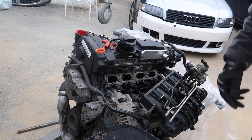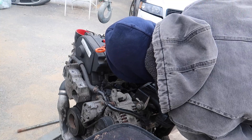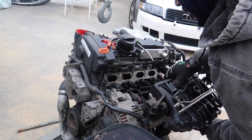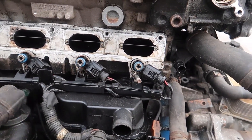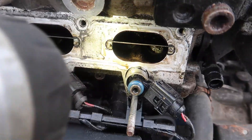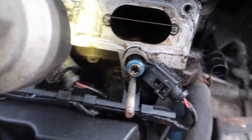What we have here today is the engine that we were supposed to work on yesterday, but we had to stop because I stripped one of the bolts on the intake manifold and that bolt was taking forever to come out. Night was coming down anyway so I had to pause. Today we're just gonna rip the intake manifold off, the turbo, and take off the cylinder head. Let me go ahead and remove that PCV line real quick — that line comes off really easy once you release the tabs and move it around. There you go, just like that — the intake manifold is now free. It's a good sign that the injectors stayed inside, because if they didn't we'd have to replace the seals. The carbon buildup guys is pretty dirty in this engine — pretty nasty inside.